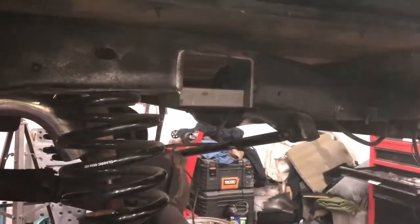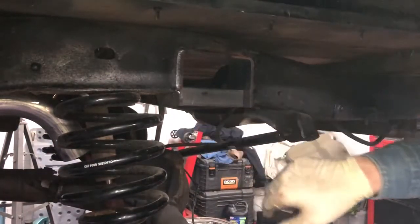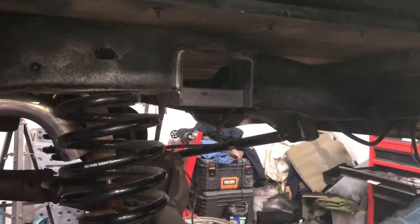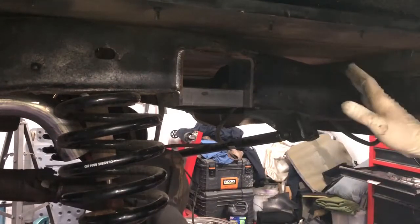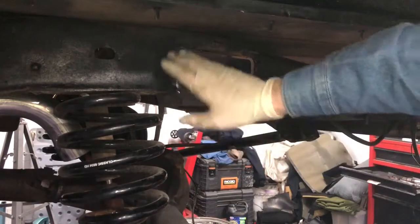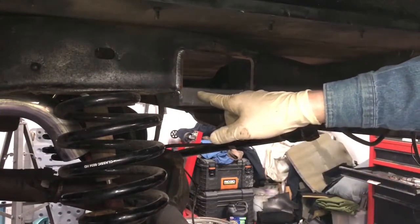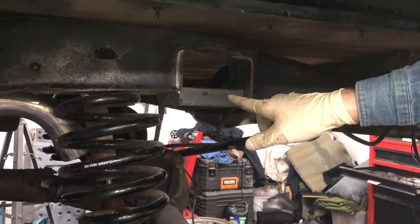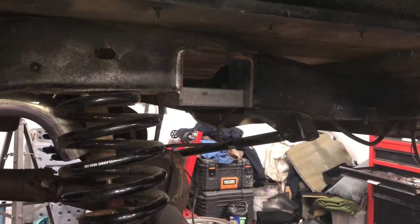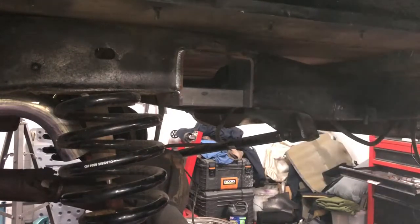And again, I need to point out two things. One, yes, I'll be cutting the excess off the bottom. And two, this is not a work truck. This truck will never have anything in the bed. This truck will never have a trailer. Nothing is going to be affected by taking this much out of the frame. And frankly, that piece of 1/4 inch A500 structural steel is probably as strong or stronger than the piece that we just cut out. So I'm going to knock my reinforcement plate out, cut the bottoms off, and call this side done.